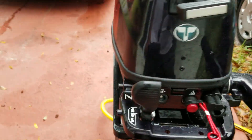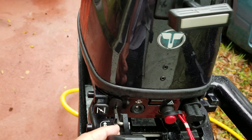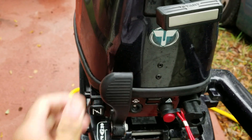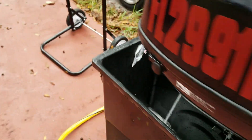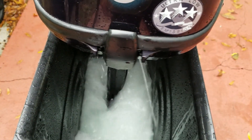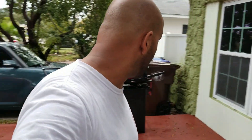During this time it's a good idea to run the gear a little bit so any debris within the propeller gets cleared out. You're going to run it in reverse, then forward. Although it's a small bucket it has plenty of space to run the propeller without hitting the sides. I'll also put some links for these materials below from Amazon for your convenience. Alright, it's been about five minutes — I'm going to go ahead and shut off the gas line and let it run until the carburetor dries out.